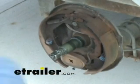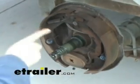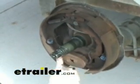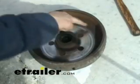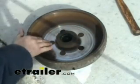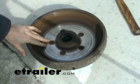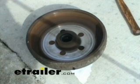These look pretty decent — they just have a little bit of rust coating that can be cleaned off. On the magnet, this actually rides against the inside of the hub — it rides on this polished part right here constantly, which is what it's supposed to do. When it gets energized, the magnet sticks to the spinning hub, and that's actually how it makes the brakes work. The magnet is designed to wear down over time, just like the brake shoes.